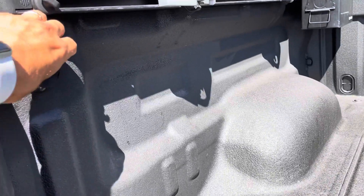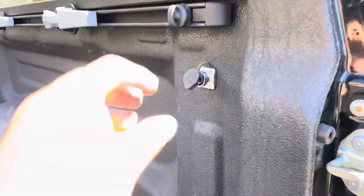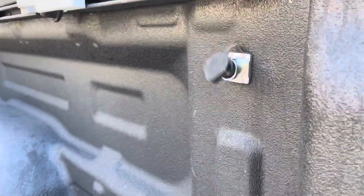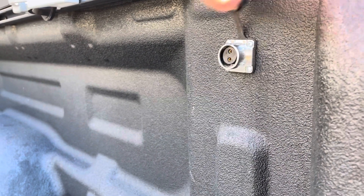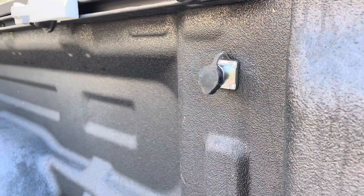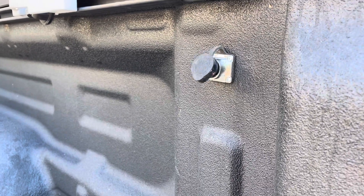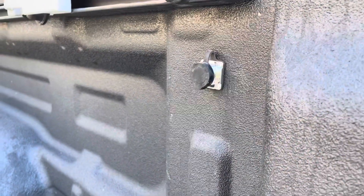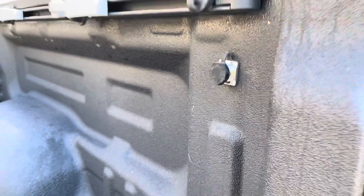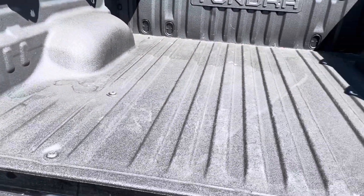On this side I've got one of those portable coolers that runs off DC, and I added a 12-volt plug over here. That plug may not look familiar — it's not a standard DC plug. It's actually a 2-pin aviator plug with a latch. I chose it because it allows for 30 amps continuous current at 12 volts, so it's plenty for a fridge. It's also watertight, has a cool little cap, and it looks great in the bed. So from here there's DC and AC.